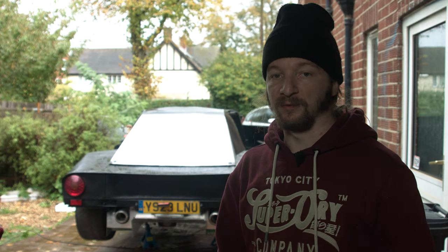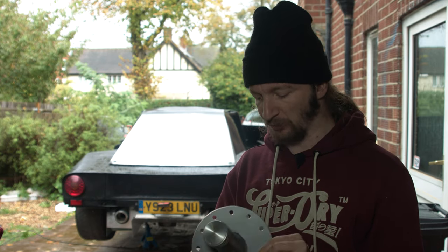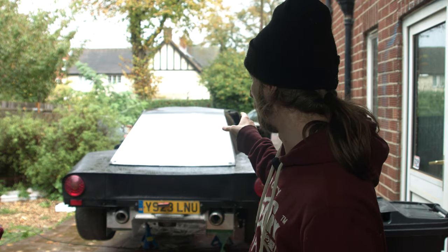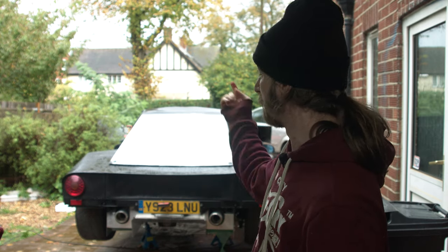Since we're still scrambling for things to do with the weather and waiting for parts, we're going to have a look at fitting a fuel filler neck. Unfortunately we screwed ourselves a while ago when we installed the fuel tank — we forgot to put a removable detachable connector on the two wires for the level sensor, so right now it's hard spliced into the rest of the car's wiring loom. We're just going to snip that, bring the fuel tank in, and later add a proper self-sealing connector so we can remove it properly in future.